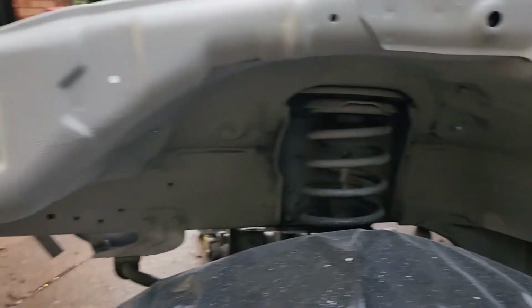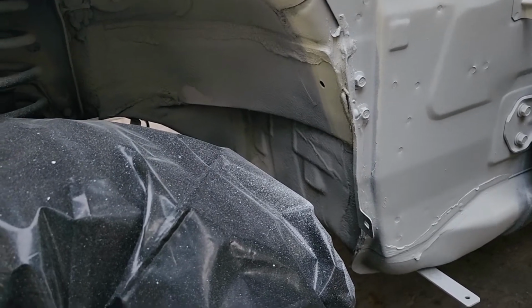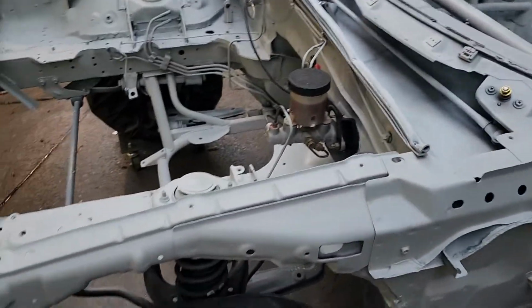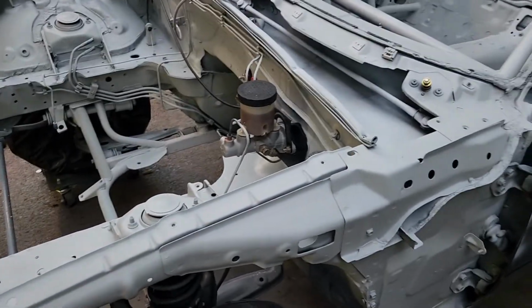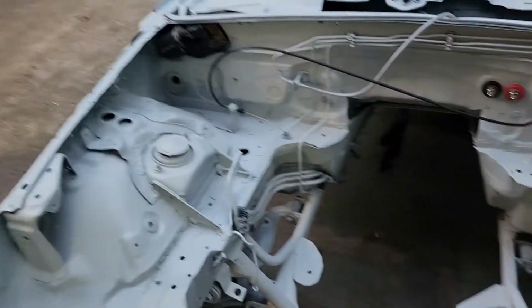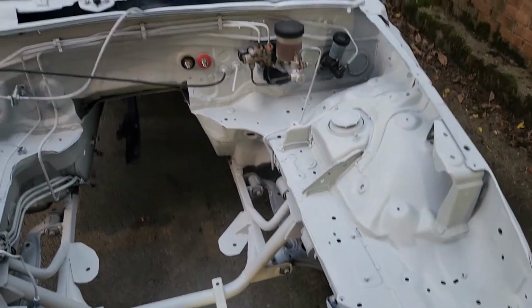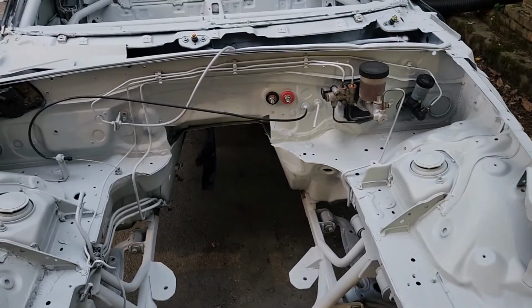that's pretty much it. I was able to get the inner fenders really well. We'll see how this stands up. This is like, I don't know what you would say, probably one to two heavy coats. I didn't want to mix up a whole batch and do several coats because the stuff was very hard to get to spray on. I pretty much had to have everything on my gun maxed out for it to just spray without splattering everywhere. But yeah, I'm pretty content with how it looks. We'll see how it does on its first pressure wash from a race or something.